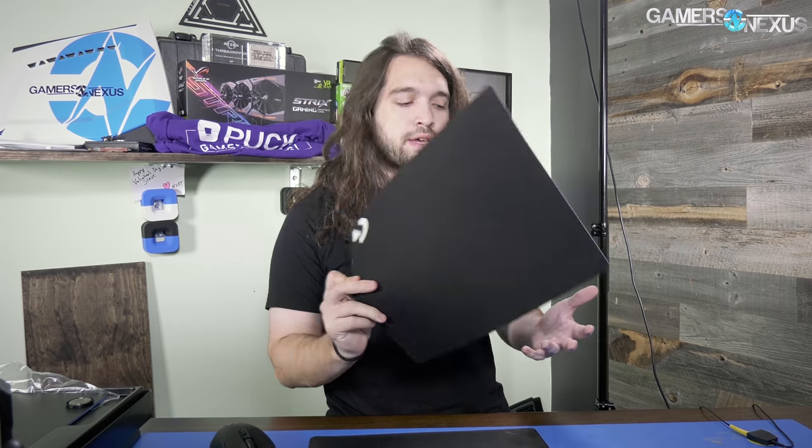What Logitech trades in efficiency they make up for in convenience — a mouse charger built into the mouse pad makes a lot of sense. Corsair was also showing a prototype of something similar at Computex. The core idea: the mouse pad is an extra hundred dollars, and you can throw a mouse pad on top of it — as long as it's not too thick and not metal, it'll work. Keeping the mouse centered is best for charging; it still charges toward the edges but faster in the middle. During normal use on the mat, the mouse basically doesn't discharge or charge — they're at roughly equal rates.